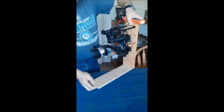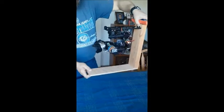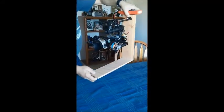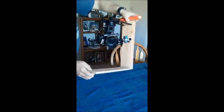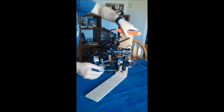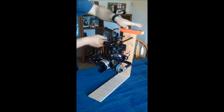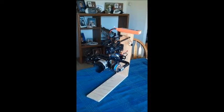The gimbal works very well. I've worked on PID settings a lot — yaw is great, roll is great — but this is what happens. Look at that. I've adjusted the PID settings all the way up, all the way down, maxed them out, done everything on this, and I've been playing with it for two weeks.